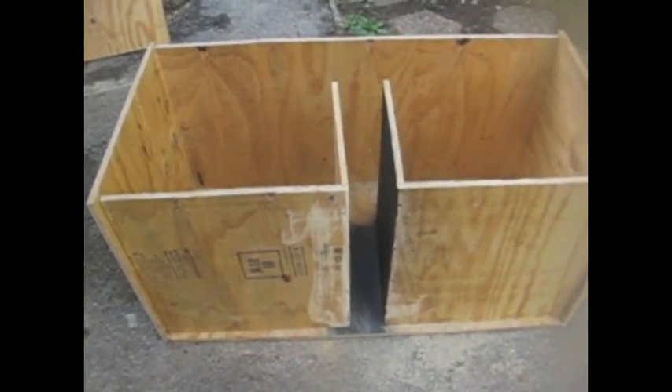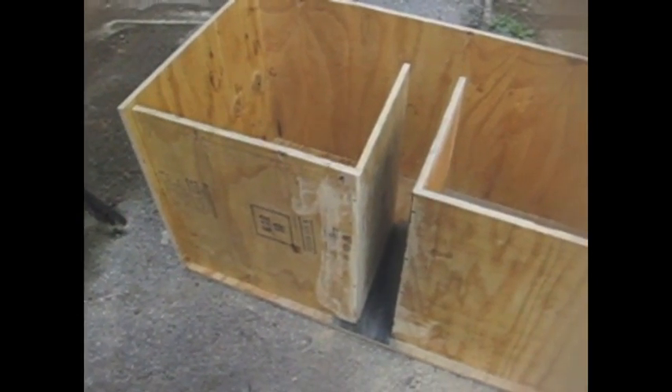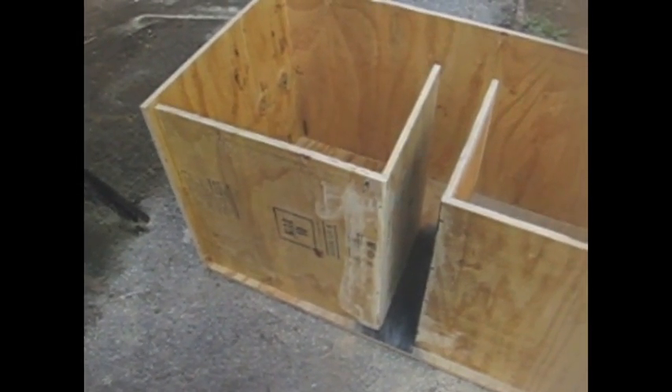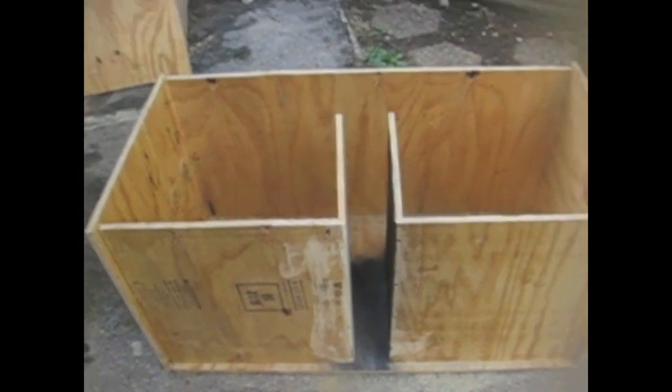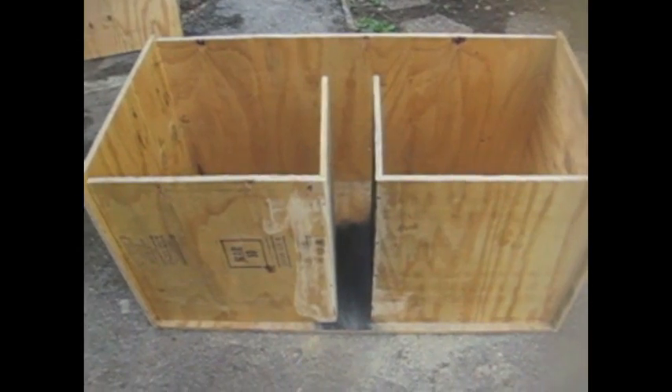Here's a good idea of how it's going to sit. Basically, here's your overall design — the other inside panel will be black. It's easier to paint these panels and to sand them outside of the box so we don't have to do it in the corners. That's what we just did with the second one — sanded all the corners with it not being installed in the box. This will show you generally what the box is going to look like before we put the top on it and the mounted speakers.